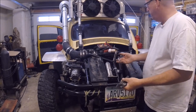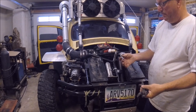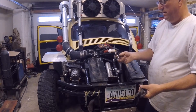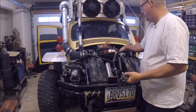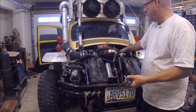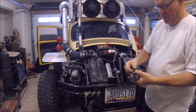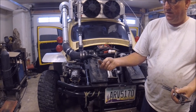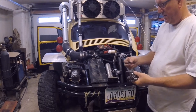I carry a few of these — time to time you'll shred a valve stem. It's not too bad to pop the tire off the bead, slip this under, tighten it in, and you're good to go. For something else that's been a show stopper: your throttle cable. This thing will eventually back out, drop off, drop down into the motor, drop into sand, and you can't find it. Out in the field it's worth a million dollars; at the store it's 49 cents.